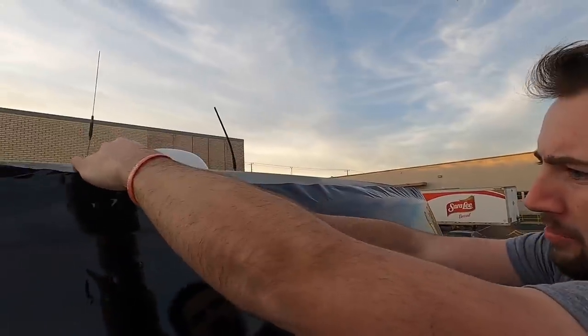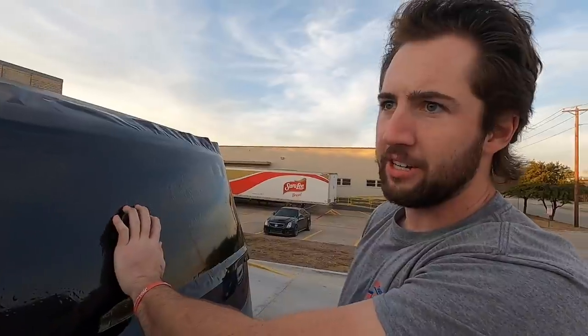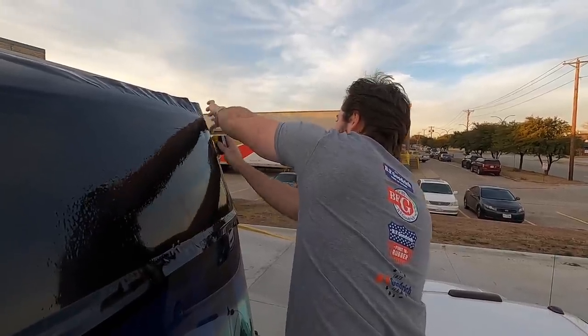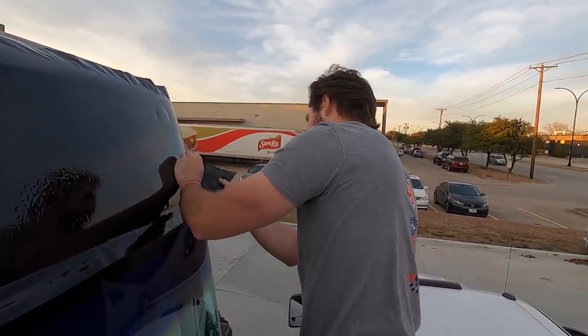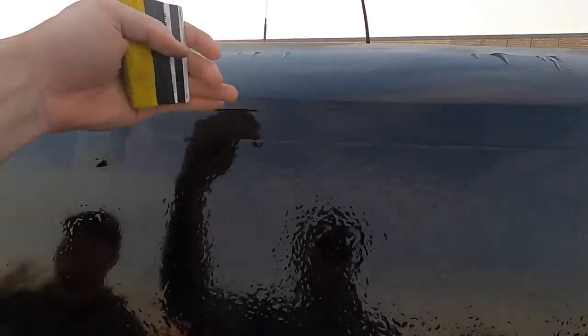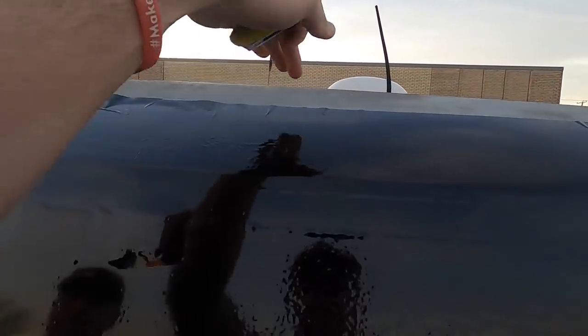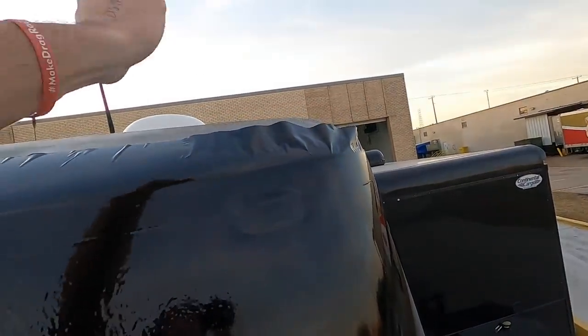In the meantime while this thing is going to be parked it'll be just fine until I can get a more permanent solution. I can always cut it off and trim it later. When I go to wrap this legit I'll take a DA and knock all this down and then it will come off fine. Now as I'm getting up to the top it's getting harder because it's on the edge. That's why you always want to cut way more than what you're going to use, because the extra material helps you work it easier. Fighting with these edges can get a little annoying. Especially here — to wrap this corner I would have cut out way more and then heat a little bit and then stretched it over. Just a little tech tip for you guys.